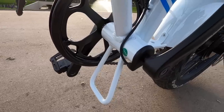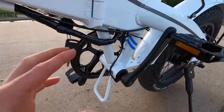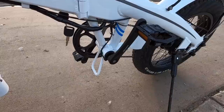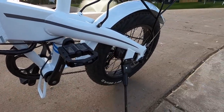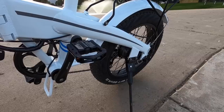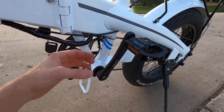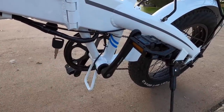One area I really like: they went with a sealed 12-magnet cadence sensor. A lot of cheaper bikes use a big disc with visible magnets and a frame-mounted sensor that can wobble and get bumped out of place over time. There's a bit of a delay starting and stopping — that's how the controller is set up, something they might tune over time. The controller is a square wave 18-amp — pretty zippy, giving a lot of power. The 500-watt nominal motor peaks over 900 watts with 60 newton meters of torque.